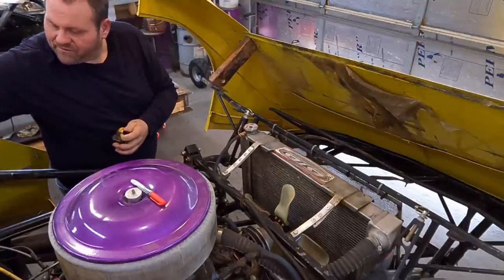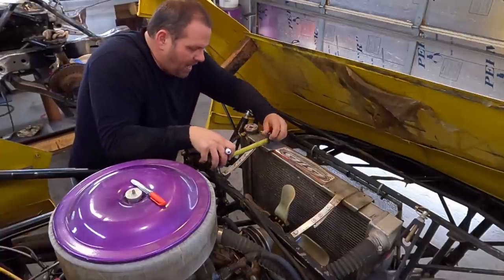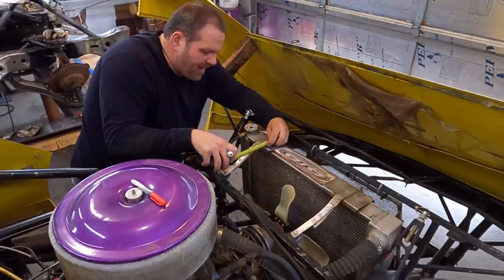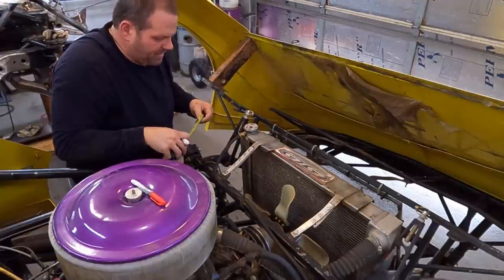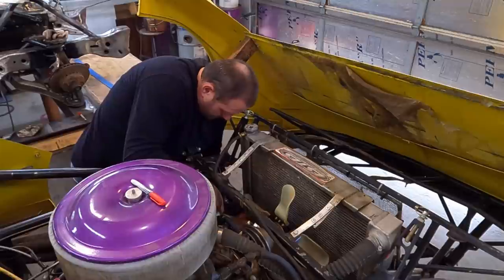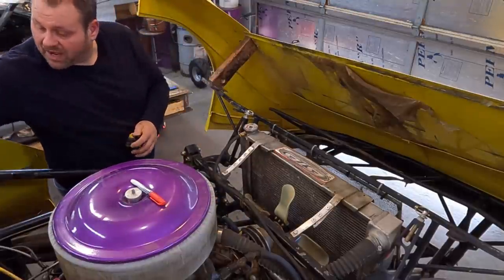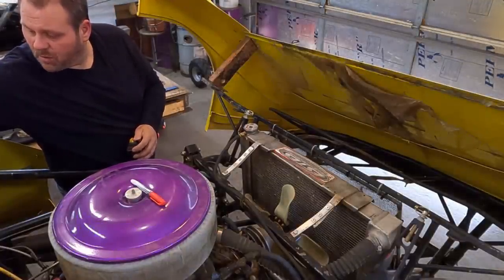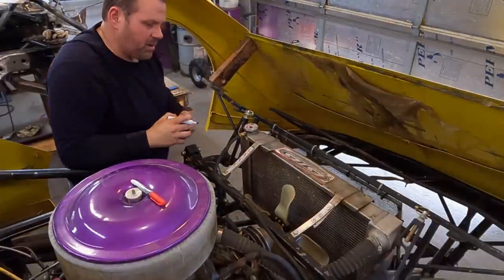We're gonna do a 20.5 sheet in height, and we'll wrap it over the top by 1 inch, which will be fine. So we'll put a 1 inch bend in the top, notch out for these pieces right here, and then let's see what it's gonna take to get the bottom up there. It's gonna take 2 inches to get the bottom there. All right, so I got 20.5 with 1 inch on the top and 2 inches on the bottom, so I'm gonna take a 23.5 inch piece. So 23.5 inches long, and we'll put our bends in it.